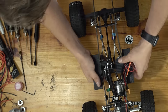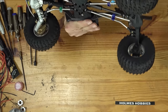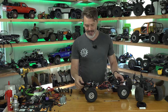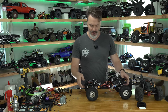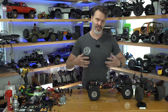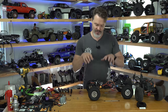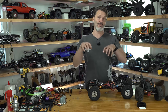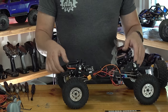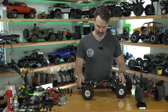On the front of this chassis there's pretty much no option for changing your link positions. The front anti-squat really isn't as imperative on a crawler — if this were a high-horsepower formula off-road or racing rig, you'd need to tune the front because you're going fast and how your suspension reacts under load matters a lot. But on a crawler the front is what it is; it's always going to hook. You really need to have the rear predictable.